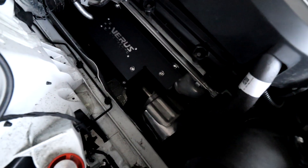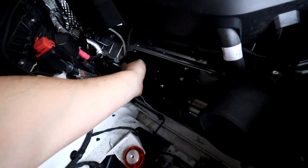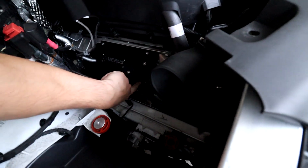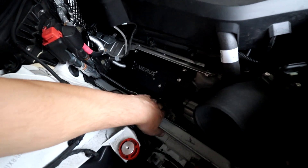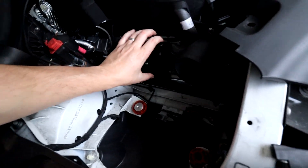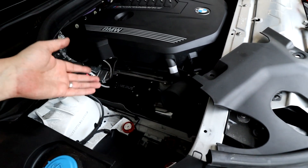Here it is — it actually looks really good. There's plenty of space between the wastegate arm and the wires. It's perfectly designed, fits like a glove, no problems whatsoever with the six-port. Again, the six-port is LCI and up — 2022 and up — and the two-port I believe fits 2018 through the pre-LCI models. No problem, perfect fit. You can see it covers the whole turbo, so the turbo is now enclosed in the heat shield, and all the heat should technically go towards the downpipe.